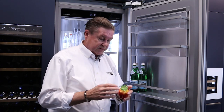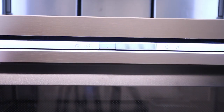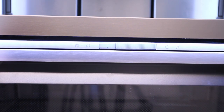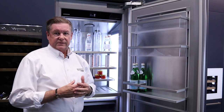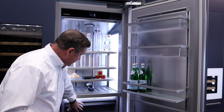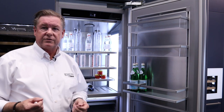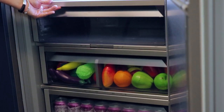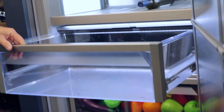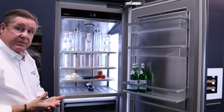That gives you additional time to consume the produce, and if you consume it you're not putting it in the landfill — so there's an ecological advantage there. There are two settings on the BioFresh chambers: one for fruits and vegetables, shown by the vegetable icon, and another setting for meats and cheeses. With meats and cheeses, you move a little more air through and have less moisture. With the fruits and vegetables setting, you have more moisture in the chilled environment. The fan pulls the air, pushes it over the evaporator into the crispers, dropping the temperature and raising the humidity, then dispensing it out the front.